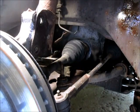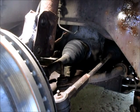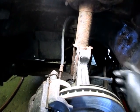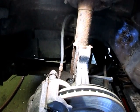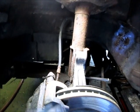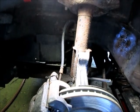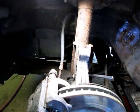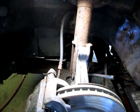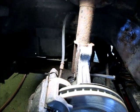I'll have to get a punch to get that one up the rest of the way — seems to be kind of stuck. We got both bolts out. When we pulled the steering knuckle forward it really tightened up on the brake line quite a bit, more than I'm comfortable with. So what we're going to do is pop off the tie rod end so we can swing it out of the way a little bit — that should give us more room without yanking on that flex line for the brakes.